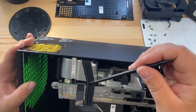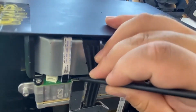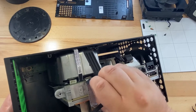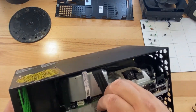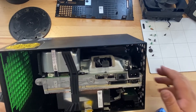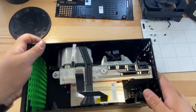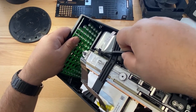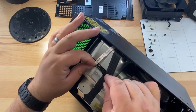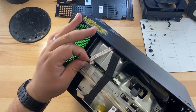Now you can't just pull on these — there's a little tab that you need to click up. So we'll go ahead and gently get in there and flip up this tab. There — you see that? That way we can pop this connector. It's a little oily inside of here too. And I believe everything is ready at this point to come out. Oh, I got one connector I forgot right here. Now this one's a little tricky as well. Instead of pulling something up, we're going to be pushing it down on top of the connector — you'll actually feel a little metal bracket that pushes down, and then it just pops right out like that.